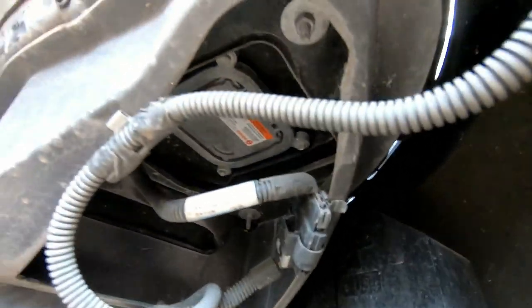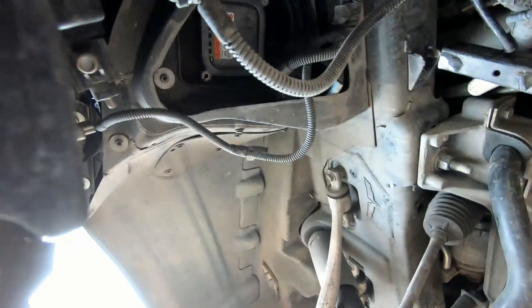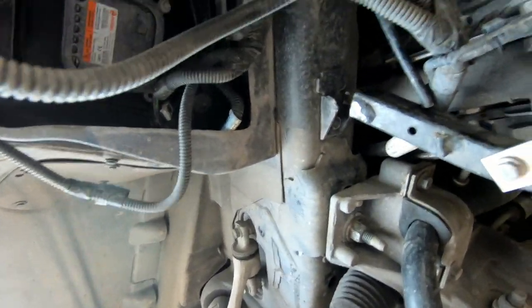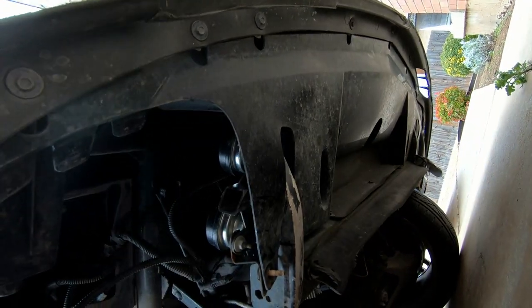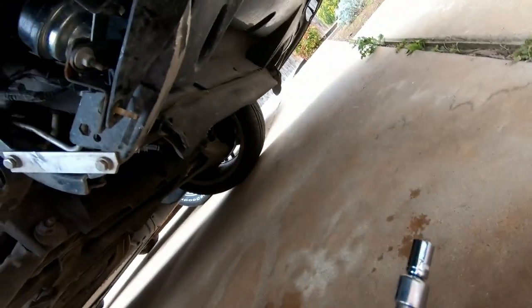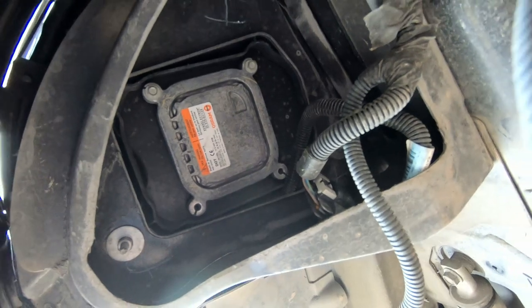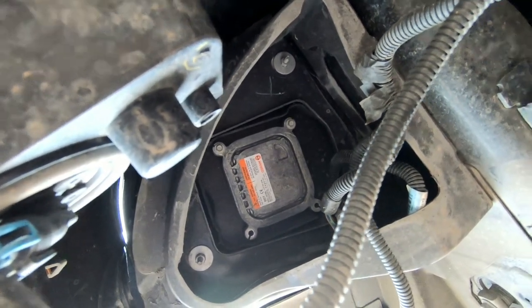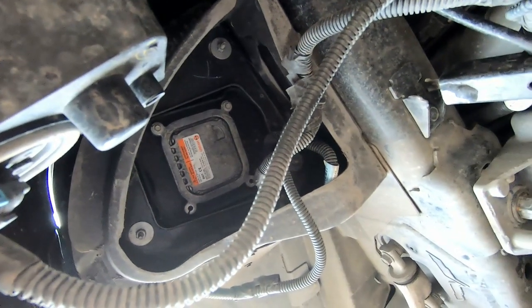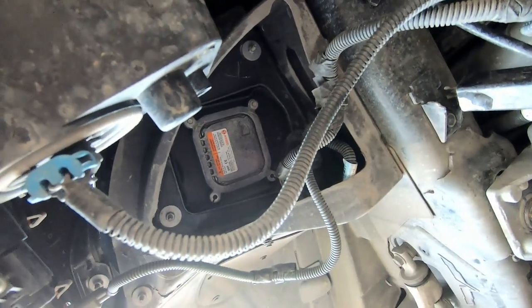It shouldn't be too hard, but I was hoping it would just be open — but of course it's not, that's a Corvette. Now I've got everything off and out of the way. That's the ballast, and I'm going to take a 7mm socket to pull out the four screws that hold it in, and hopefully I won't get electrocuted or anything. I've never done this before, but so far it's been relatively easy. It shouldn't be so hard to change out a headlight, but HIDs have ballasts, so you've got to change them out.